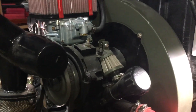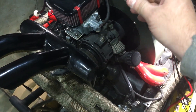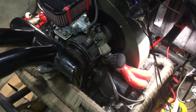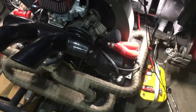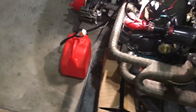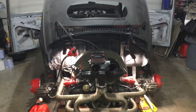It's 11 o'clock at night so I don't really want to wake the neighbors or the family, so I'm not going to start it up. But I can show that it does indeed turn the engine — it wants to start but it doesn't have fuel. I'm going to crank it a few times just to get oil moving through the case, making sure the pistons are lubed and not seized, and the rockers are adjusted properly. I'll test it on a Saturday and stick a hose in the fuel tank and actually start it.